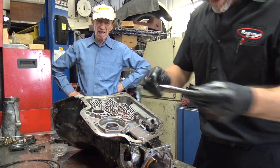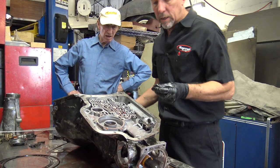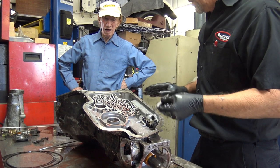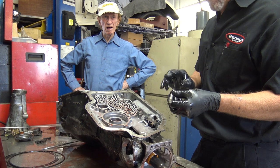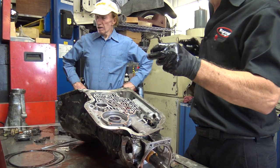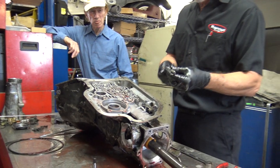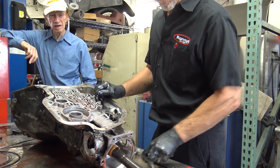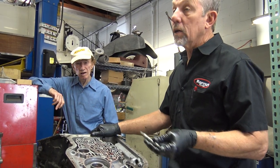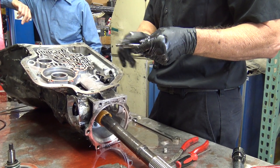Here's another source of leaks. This shaft has a metal housing seal with a rubber lip seal on the inside, and it seals on this shaft. Changing this in the car is real fun — they make a special tool, a puller that screws onto the inside of the metal lip, then a bolt pulls it out. I've seen a lot of these shafts where people without that tool will take an awl and drive it in to pop the seal out, and they'll scratch the shaft — and then it's going to leak no matter what.